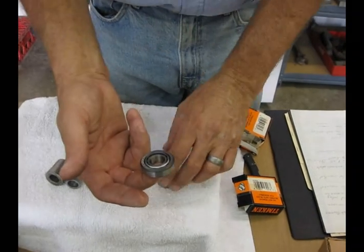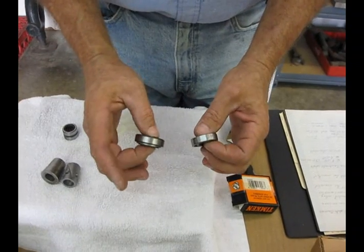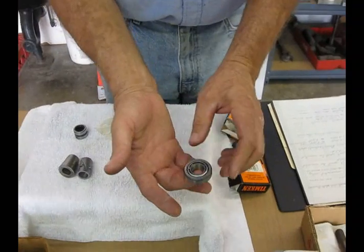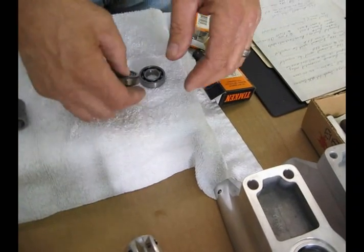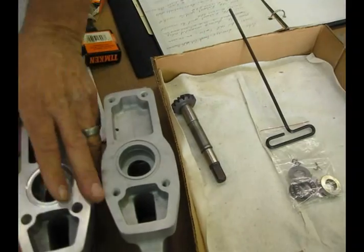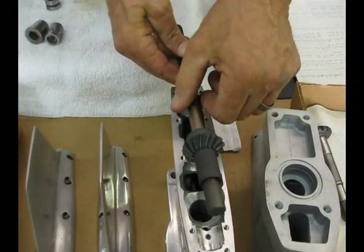All of the problems stopped. What that bearing will do is absolutely locate that pinion shaft, so your tower shaft stays perfectly in phase. When I shim out this package, I shim all of the play out and actually lock this shaft in space — it should have no play back and forth whatsoever.